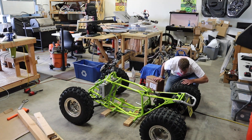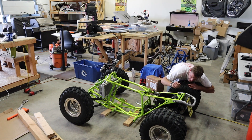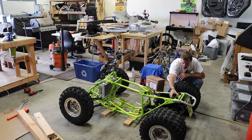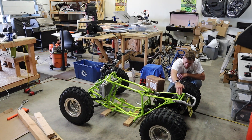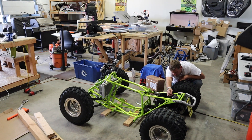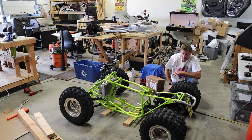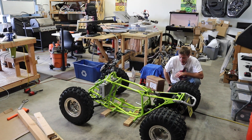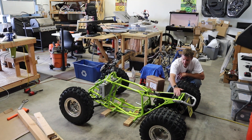What I see here is the back of the air box, the bottom, is hitting the tube of the swingarm. Partially it's because the rear of the air box is down about a quarter of an inch, because I made that custom bracket for it — this custom poly. The only reason I did this is somebody cut the air box mount off the rear here, so I had to alter the design a little bit to make it work. What I can do is actually move this from below the bracket here in the rear to up, and that would gain me probably about three-quarters of an inch of extra travel if I just switch that around.